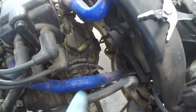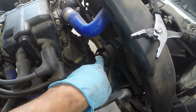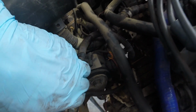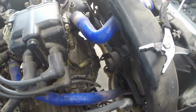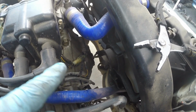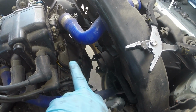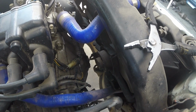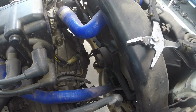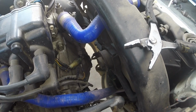Now, I already removed my front motor mount when I got this car a long time ago because I have Hasport mounts on here. It is unnecessary for me to have it. The mount had disintegrated, so I never threw it back on. You are going to need to account for that mount. It is only 2 bolts which hold the mount to the transmission and 1 which attaches it to the subframe. Very easy to remove. You could remove that first before going any further.